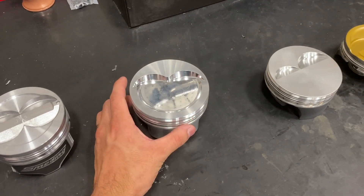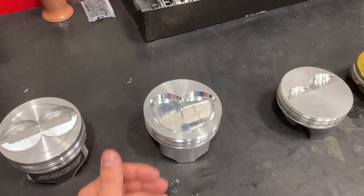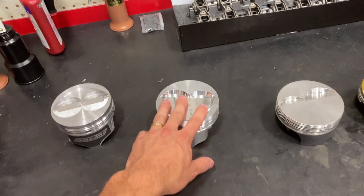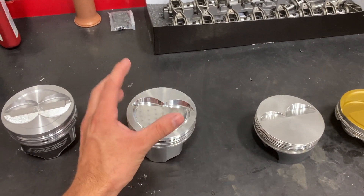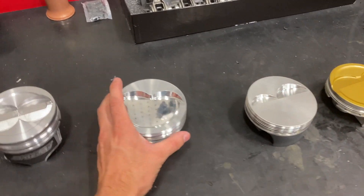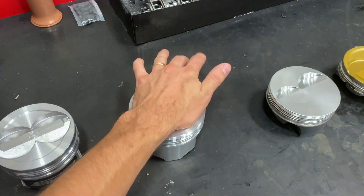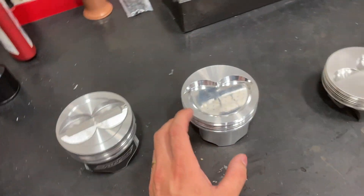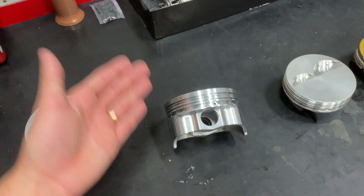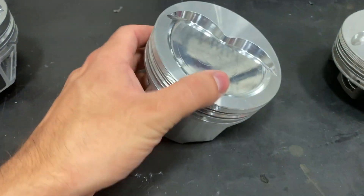The 4032 has very little thermal expansion because of its higher silicon content compared to 2618. We use these pistons in very high performance, naturally aspirated street engines. You can fire the car up, immediately get on the highway, and you'll be fine because this piston has less bore clearance than 2618 — it's already tighter. Because these are forged, they are much more durable; they can take impacts and abuse and won't shatter or crack like a hypereutectic or regular cast piston. We use these on mild performance daily drivers, and you can do offset or center wrist pins and any ring you want.